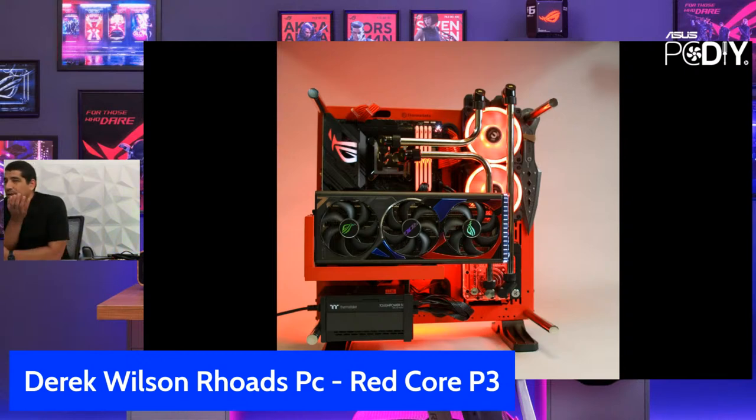Now, in that situation, I don't know what the speed is, but that would probably be the only thing. I think aesthetically, of course, for some people, they like it a little bit more because you have that complete contiguous RGB lighting line. But of course, with a 13900K in this board, and he has got a good IMC, you could probably run even higher memory clocks. You could be running like a 6800, 7000, maybe even 7200, right?